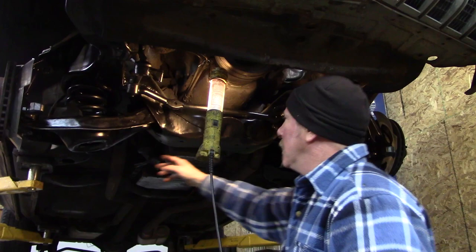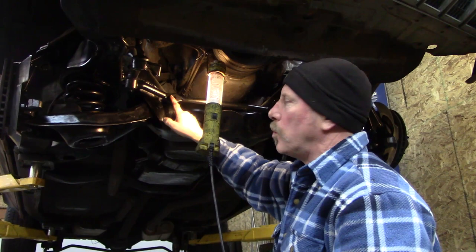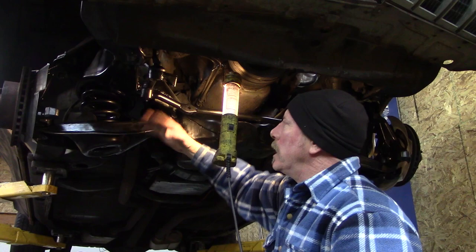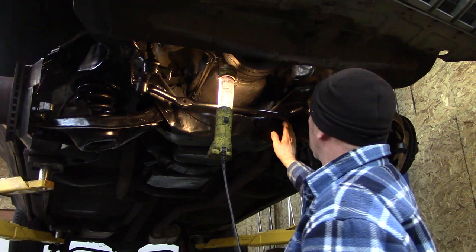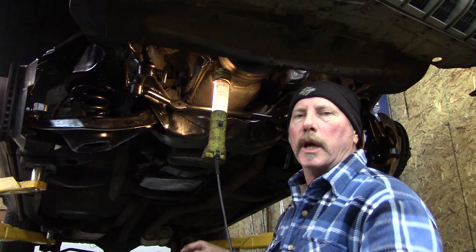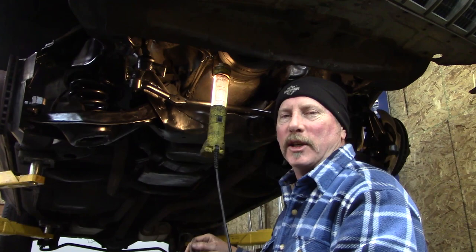This is all engineered out for you already, but if you were ever building suspension on a vehicle, you can see how the center link goes up and down when you're going over bumps, and this line intersects through those holes. These things have to be at this geometry point for the suspension to go up and down and pivot so you don't get unwanted steering input during travel.